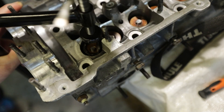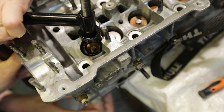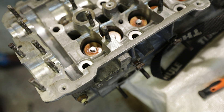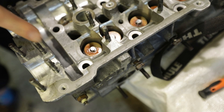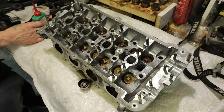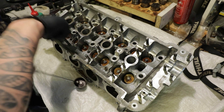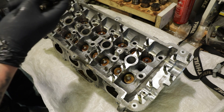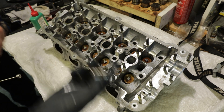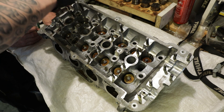So I guess now we need to put a bit of oil in here and get the cams back on. We're just going to put a bit of oil on top of each of these spring caps. And we're going to dip these in a bit of oil as well - the hydraulic lifters - so it's nicely lubricated. Put them back. There we go, that bit's in there.